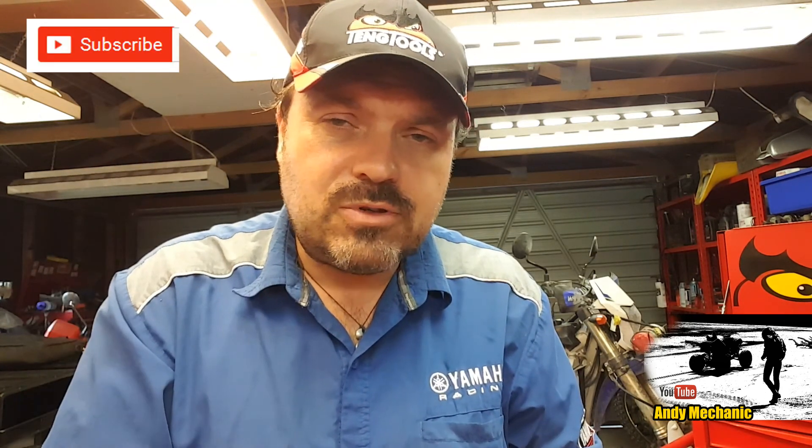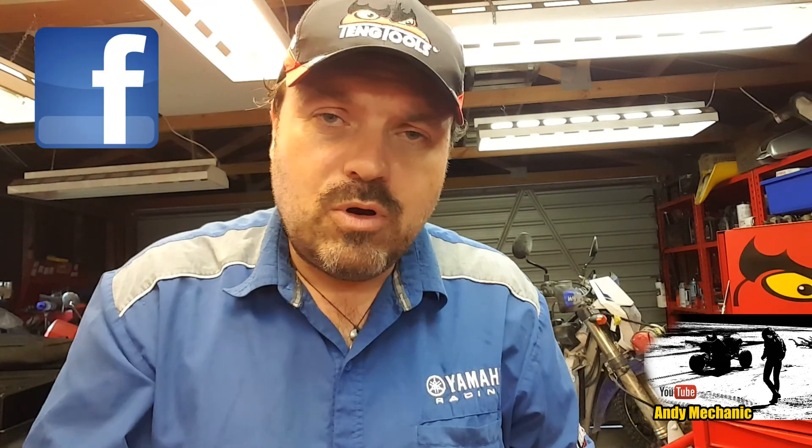I told you that would be a really quick video, and it is — there's not a lot to it. For the time it takes to set up that PicoScope and capture some live waveform data from the signal wire of that sensor, and then compare it to a known good, you can say yes it's good, no it's not, do we change it or not. Simple as that. Hopefully you found the video helpful — if you did, why not subscribe to the channel? Click subscribe, you'll see a little gear icon pop up, click it and turn on notifications. You'll also find me on Facebook, Instagram, Google Plus and Twitter. Please use the YouTube comments as your first point of contact — ask your questions there because that's where everybody looks, and other viewers do chip in and help out. Thanks for watching. Cheers, over and out.